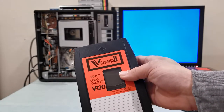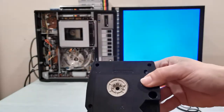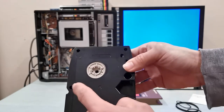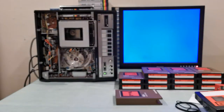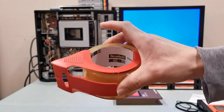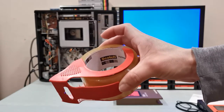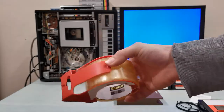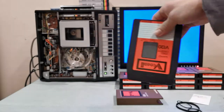That actually happened to me once already with this tape. I had to open it up — it has a total of six Phillips number-one screws. Remove those and you can get inside and repair what they call the splice. I use regular Scotch brand tape. I know there is proper splice repair tape available on eBay and Amazon, but I've used Scotch many times and never had one fall apart.